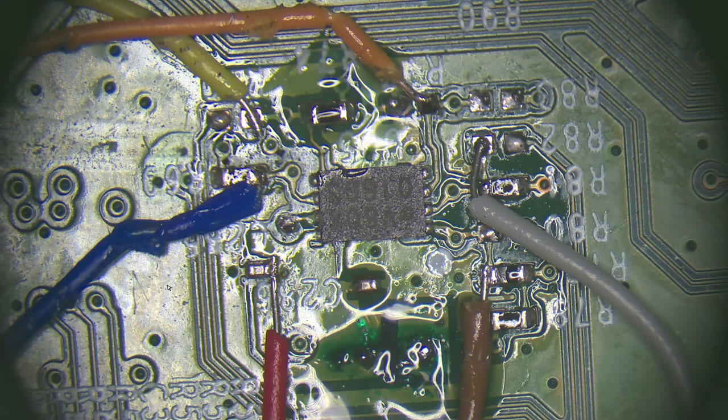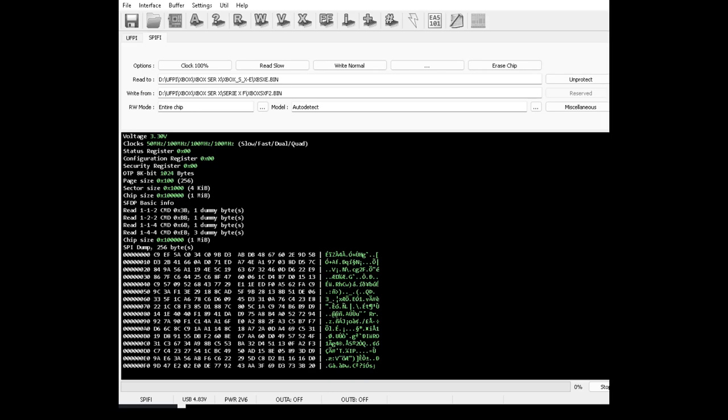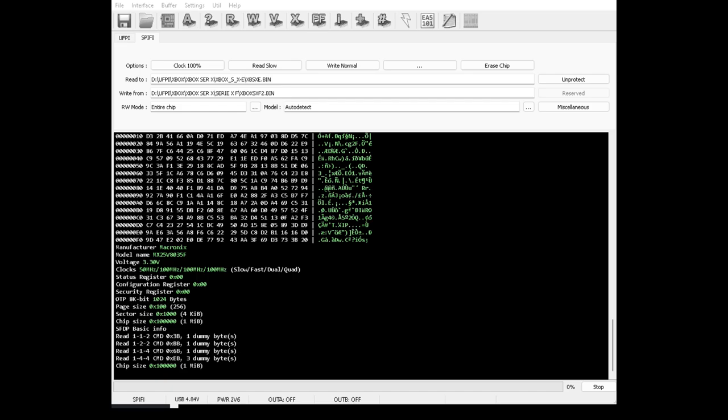desktop capture, UFPI. Okay. Well, that's actually the NOR. I'm just doing an inquiry. Here we go. There's an inquiry. So you see the data tells you what chip it is, tells you the voltage it likes to work at, although we're running at 2.5 volt. So Xbox version J. So okay, we'll open that. We'll go in there, and then we'll save the file as Xbox.